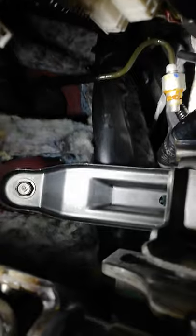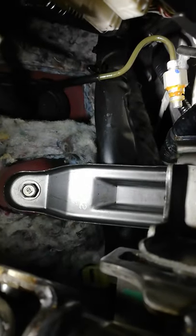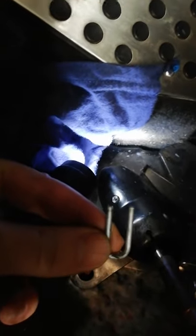The metal line coming round to the fitting is held in with a clip which you can just prise out. The other nightmare is the rubber pipe at the back — you need to pull the crimp clip back and then get the pipe off, to a face full of fluid, which is delightful. There are also wiring and loom harnesses attached to the pedal box that will stop you pulling it out, so beware of that.